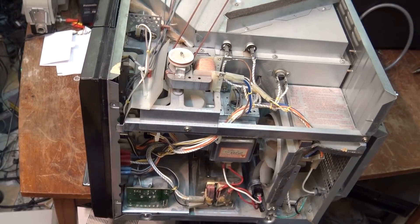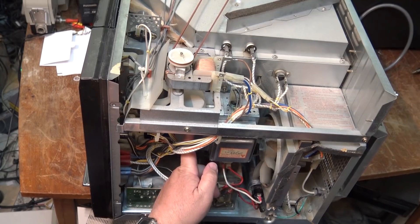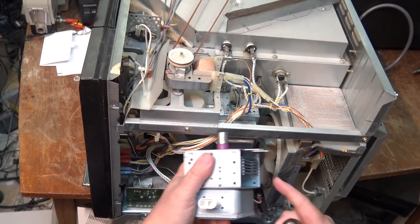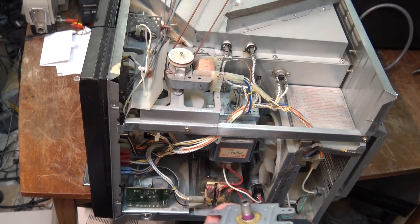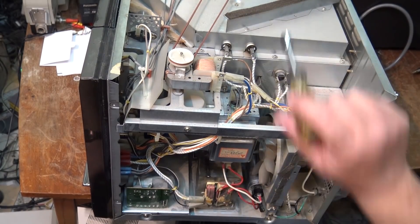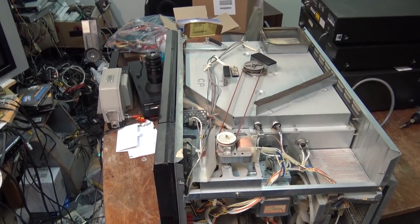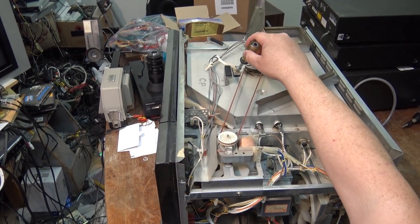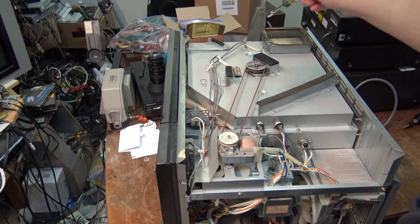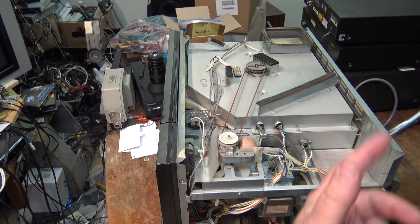What's the waveguide on this thing? Oh, they're right there. Well, that's just for cooling. The fan blows air through the fins, right? Right on the magnetron. And then it dumps the air into the cavity, which blows the air across the cavity. And this is a temperature sensor — that's for the convection. And on the back side over here, there's a humidity sensor. That's for the genius functions.